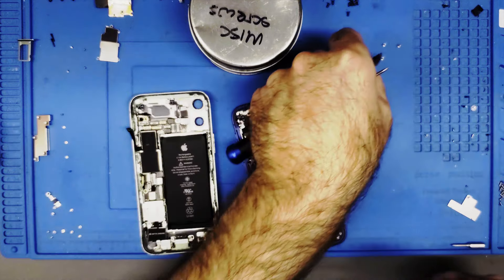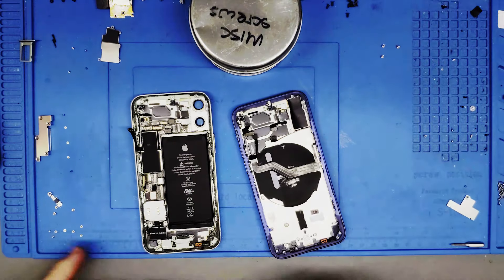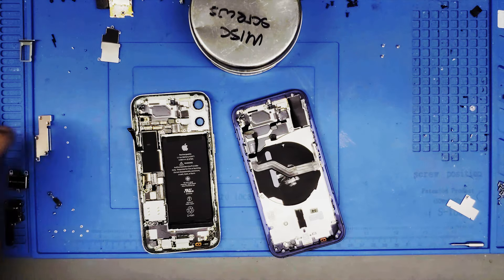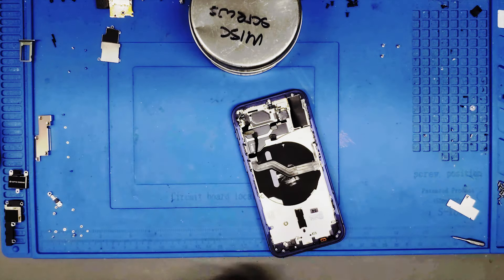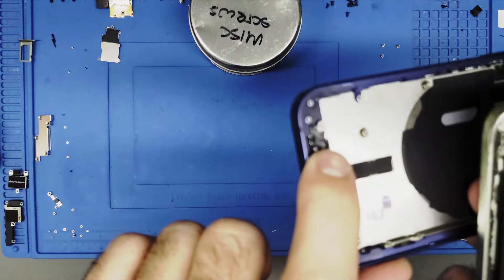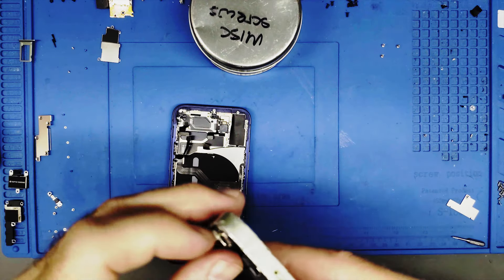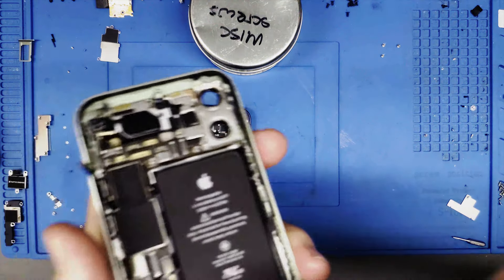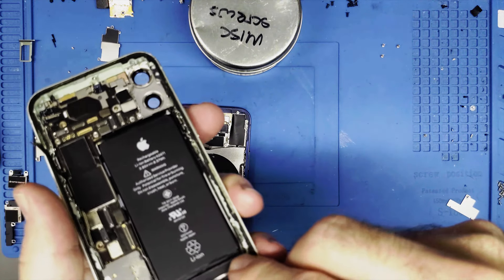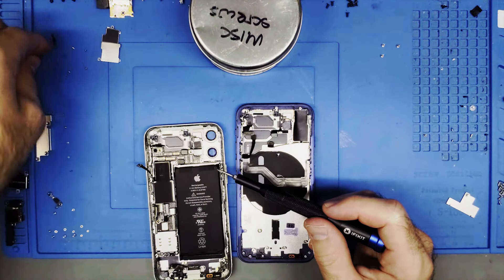Keep in mind this is a speaker — if you get it too close to your screws it will pick them up magnetically. Same thing with the Taptic motor, it has a giant magnet inside. This little piece here is a bit difficult to get out — it's suctioned into its spot and has a little gasket. You just need to get that pulled up. There was also some adhesive and another hidden screw that I nearly missed.